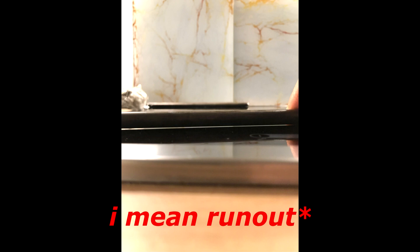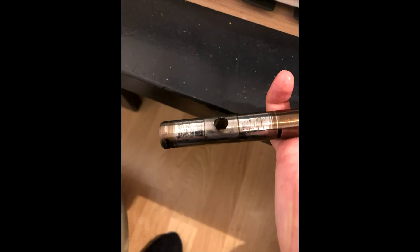After that, you want to check the part the rockers ride on. In my case you can see that it's pretty worn because the previous owner didn't change the oil properly and particles got in, which caused damage. What you should do is replace it. What I will do is turn it by 180 degrees, because I want to replace them with some different ratio rocker arms from an engine supplier in order to gain a few horsepower, as they cost the same money.